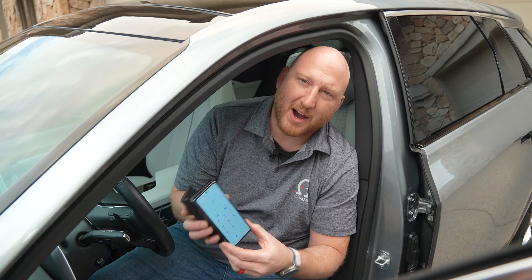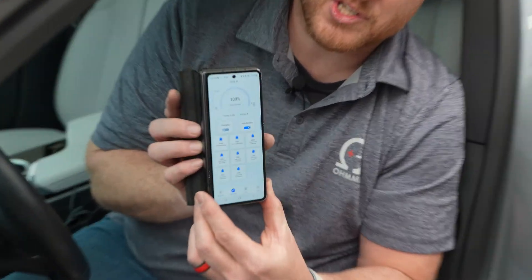This Lyriq has now been upgraded with the 12-volt lithium battery from OhmU. One of the other features of this lithium line is that we have a Bluetooth BMS built in. That allows you to monitor it through our app — OhmU Energy — and also do things like turning the 12-volt battery totally off and on through the app without ever touching the battery itself. So if you wanted to put your car to sleep for months, you can actually disconnect the 12-volt battery for a six-month period through the app without having to physically disconnect it.